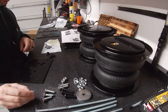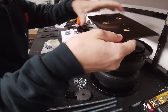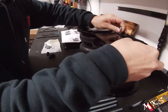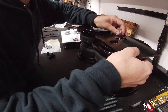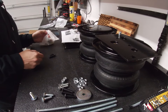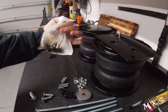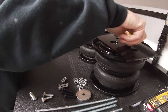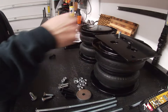You're going to take these plates and set them over the top, but first you want to make sure that you take the carriage bolt and stick it up in there — otherwise you may not be able to get it on. Next, take these bolts from bag 33139 and secure the top. You'll secure the roll plate and the mounting plate with these same bolts.